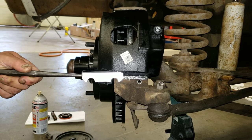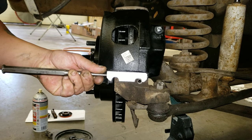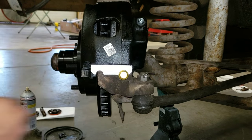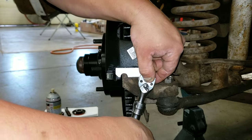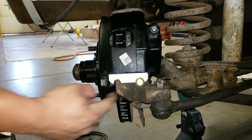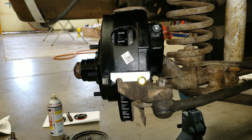Now you see where I put the grease in there. Recenter it with that hole right there. Remember that hole from earlier? So once we tighten this down, give it a little bit of torque, not crazy, we're not trying to rip the threads out. That bolt doesn't even touch this, it just bottoms into the hole. All that bolt does is keep that piece from sliding back and forth, no more, no less. Now the caliper can wear in, as this pad wears out, the caliper will slide in nice and gracefully.